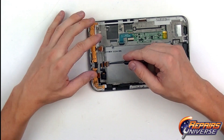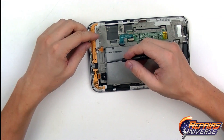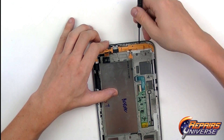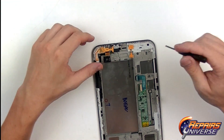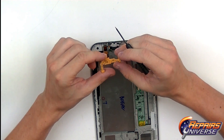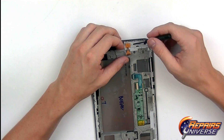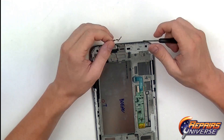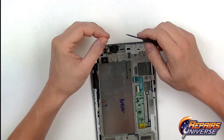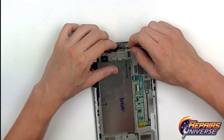This is going to be your main camera, just held in place with a little bit of adhesive. Now we're going to remove the two main spacers — the first one up on the top, just held in place with clips, so apply a little pressure and it should pop out quite easily, same with the one on the left side. There's your front camera and your sensor flex cable. Use a small flat head to get underneath the flex cable and lift it up, then remove the cover over the headphone jack and the grommet covering it as well.